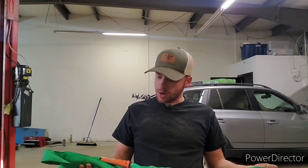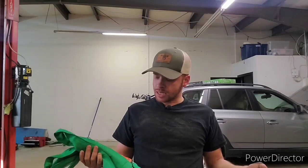The reason why I like these too is — when it comes to recovery work, if I got something down in an embankment or in a ditch, I like to grab my vehicles by the wheel as opposed to grabbing them by suspension components. The reason being is when you grab them by the wheel, you don't have to worry about damaging anything under the car and the undercarriage.